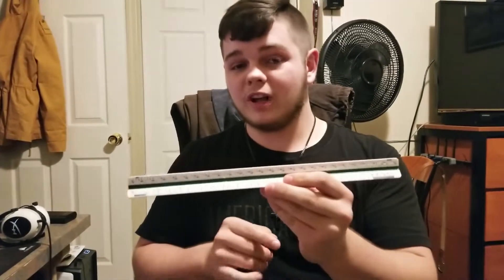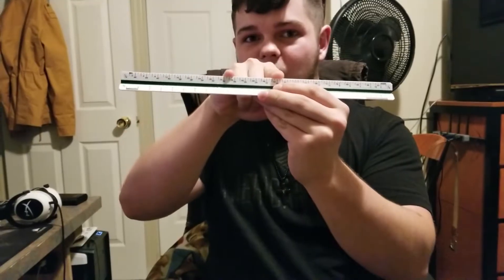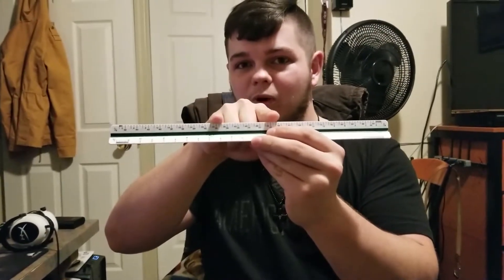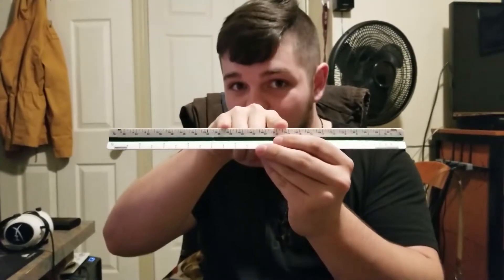Something I didn't mention is that sometimes you have a little bit of slack when setting the tension or just messing with the chain. So you might wonder, am I actually at top dead center and are the punch holes lined up? Because sometimes it'll be off just a little bit, and no matter which way you move the tooth up or down, you're way too far off. But when you have a little bit of slack, you may be right with it. When I was setting mine, one hole was sitting down just a little and the other up just a little, but I had enough leeway to move the cam chain to make both of them level. If you can move it completely level, that's when you need to set the tension and double check it.